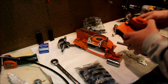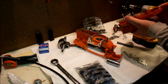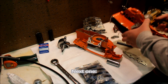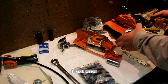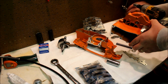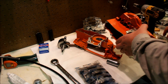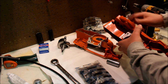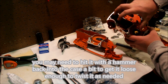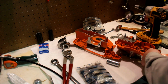And with the impact, you can actually hear that it sounds different. So that's one installed. That's a little bit off center, and I'm going to want to back that off a bit. The best way to do it is to use dual nuts. Use two nuts, tighten them one against the other, and then you can move that any way you want. If somebody has a better way to do this, please let me know.